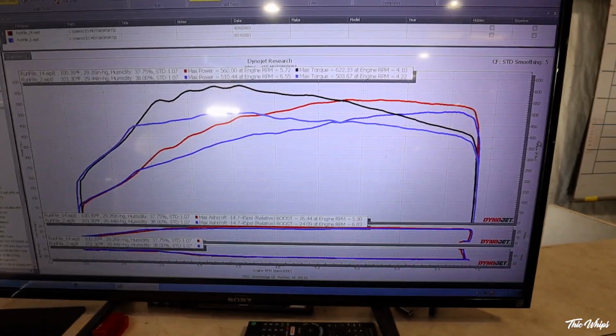So yeah, anything else to add, John? Hopefully we can bring the car back in when temperatures cool back down. Just from personal experience, anything 100 plus in the shop just sucks the life out of the car. We can be down 10, 20 wheel horsepower. The humidity has dropped now, but it was as much as 50% earlier today, and that also does not help with making power.